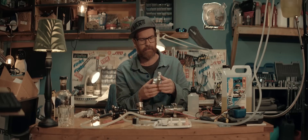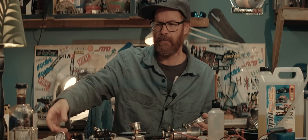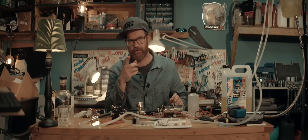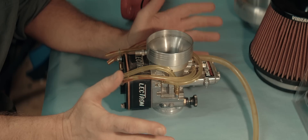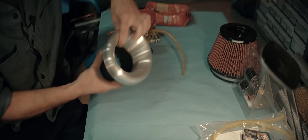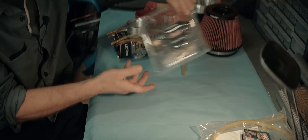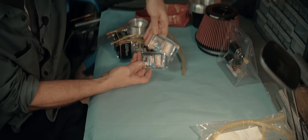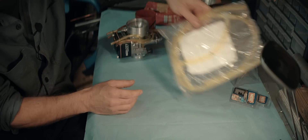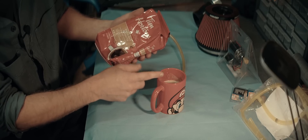I've been having some second thoughts on using this floatless speedway carb with this setup. My fear is lack of accuracy, stability, and responsiveness — I'm not sure the regulator will be responsive and accurate enough for what we want to do here. But I might have a solution. A huge thanks to Mike Dunbar for sending me this carb, and not only the carb but also a silicone fitting, a velocity stack, a huge filter to fit that stack, a little carb fuel pump, some nitrous oxide jets — pills as they call them — some tubing for the nitrous oxide setup, and this Tim Hortons coffee. Looking forward to replacing my normal coffee with this.